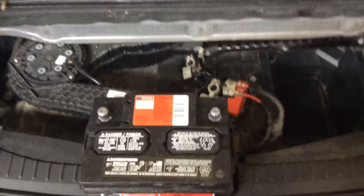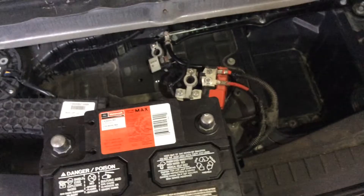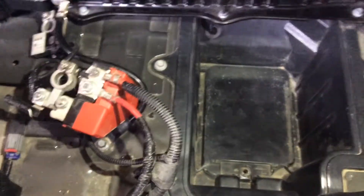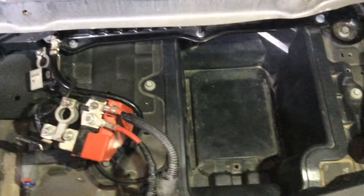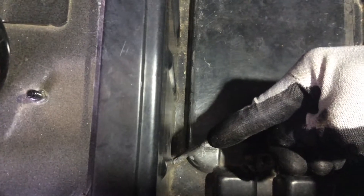I broke the spacer apart because I'm not putting it back — I want this larger battery to stay in the vehicle. The 96R group has 600 cold-cranking amps, so it should make a big difference. It fits rather snug, so you'll have to remove the tray at the back, which is held in place by two little rivets. Once the bracket is removed, there are two little webbing pieces in the front that you'll also have to snip off.